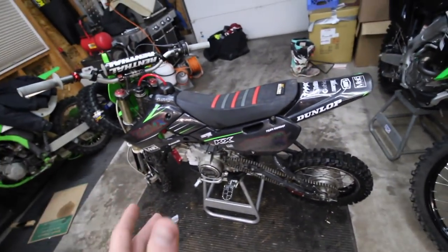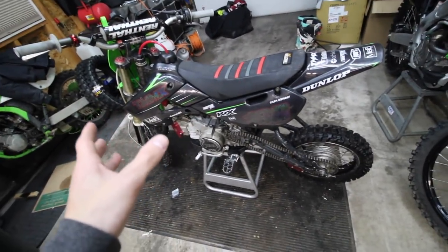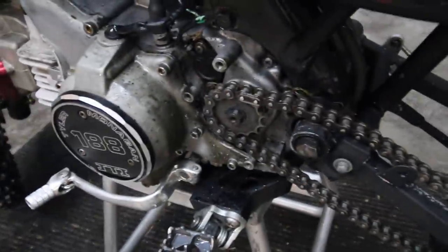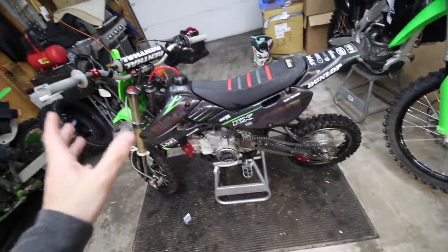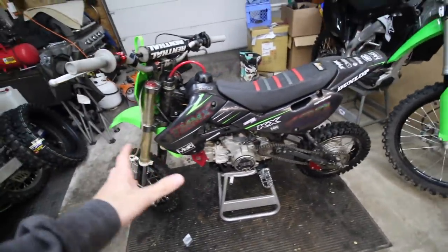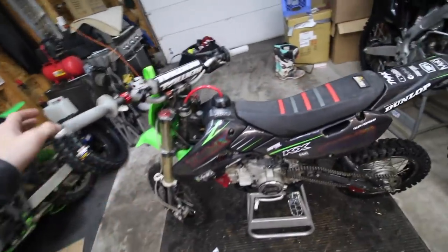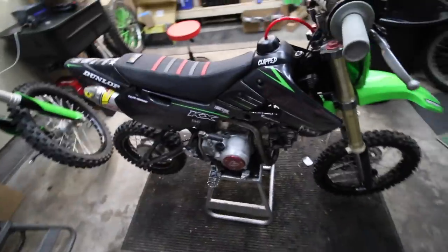The video didn't really show how bad it was smoking, but I finally have to JB Weld that case up because it's leaking out of there. I'm going to do a fresh oil change because this thing is in dire need of one. And I need to try to adjust the valves because they're ticking super loud. It's definitely coming from the valves, not the air filter. Tightening those up might actually help the starting issue too.